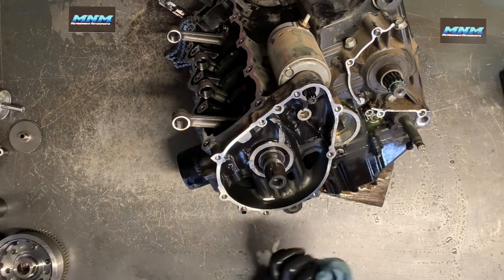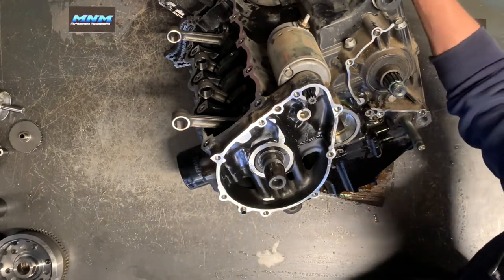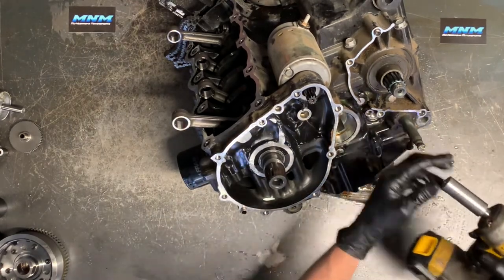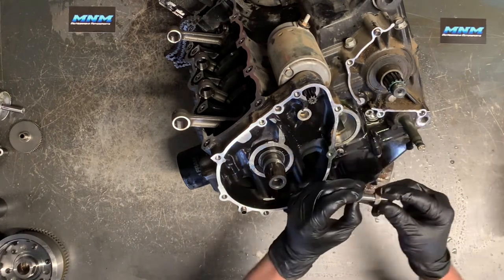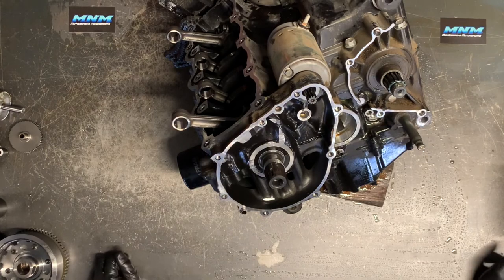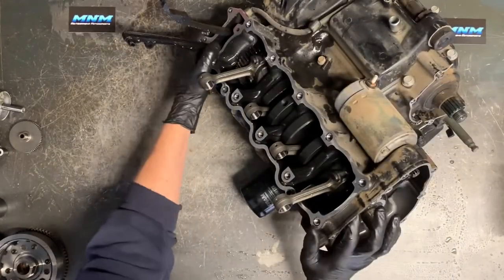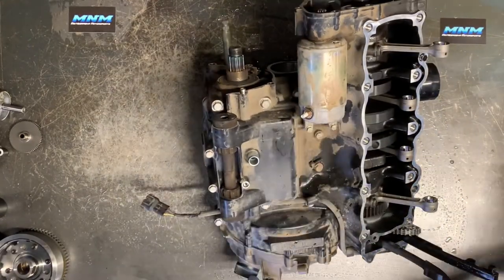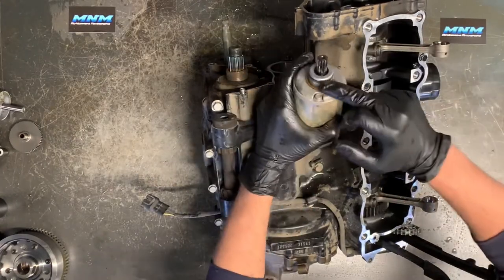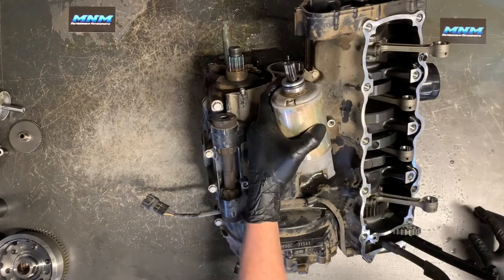We've got a sensor down here — I'm guessing this is the gear position sensor, but I haven't been to the other side yet. I'll just call it a sensor for now. It's a 14 millimeter to remove. It's a pretty common sensor — you can probably pick one up at any Kawasaki dealership. Comment below if you've got a good Kawasaki dealership in your area. Moving the motor over now — we're actually going to move to the other side. I'm going to pull this starter assembly while I'm here using an eight millimeter socket. Two bolts, then remove the starter. It should have an O-ring there that should be in good condition — you don't want water coming from this area dropping down into your stator assembly.